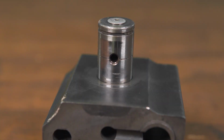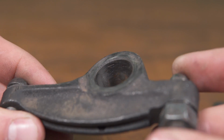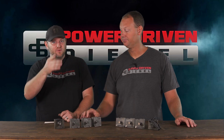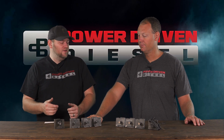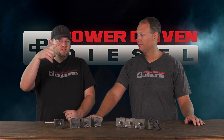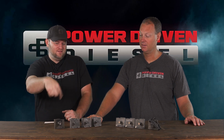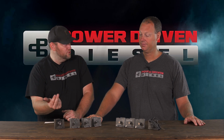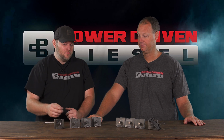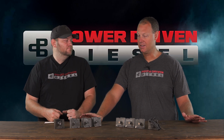I'd say half the core engines we get in, core pedestals, have seized up rocker arms on them. People are sending them in as a core because they've seized up and their engines started misfiring and they couldn't figure it out. I've seen it seize so hard that it holds the valve open and they bend the valve, because it's stuck. It's bad. So we've got an oiling problem, a lubrication problem, a rocking problem, a strength problem. For a performance application, it's not adequate.